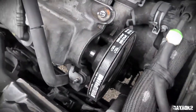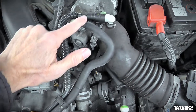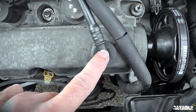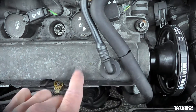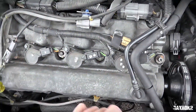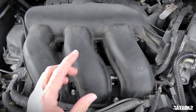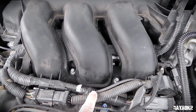I also changed the water pump belt. Regarding the valve covers — there's a tube that goes to your intake boot that comes off easily on one end but I couldn't get it disconnected on the other side without risking breaking it. So I just took it off with the valve cover when I removed it and it didn't really get in the way. Part of the whole job is taking off the plenum — this is actually called the plenum and not the intake manifold. The intake manifolds go between the plenum and the engine block.